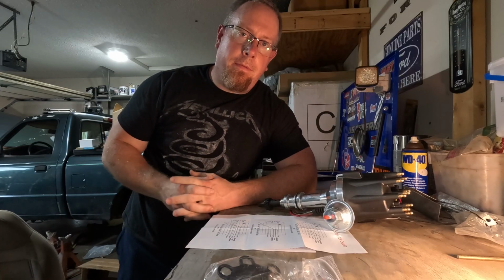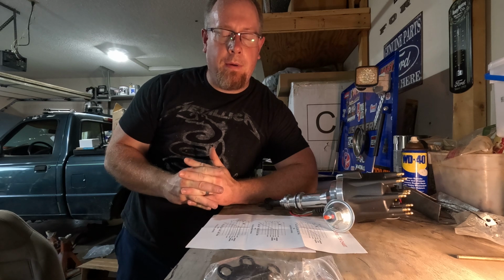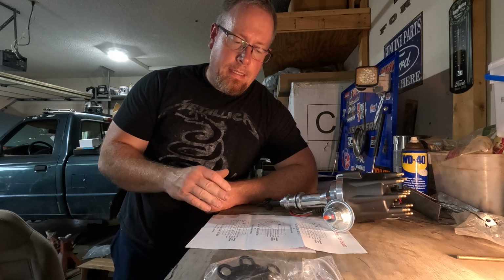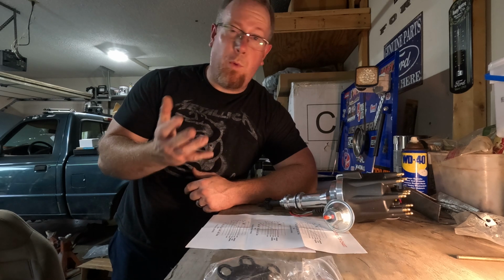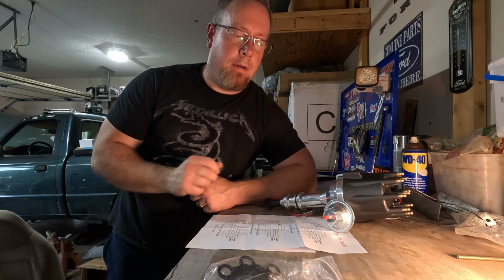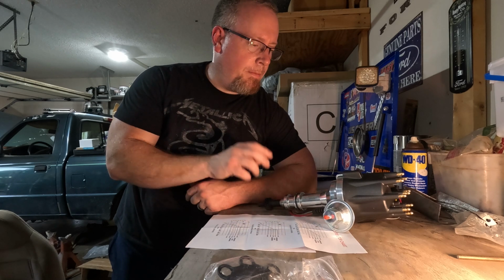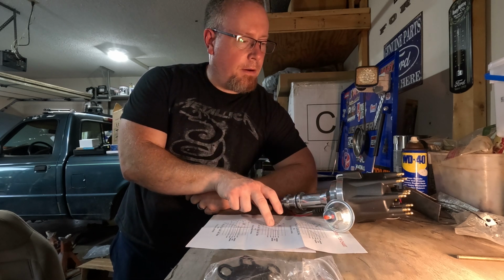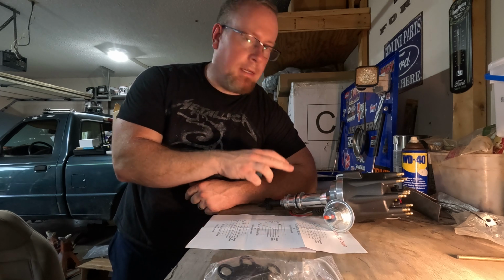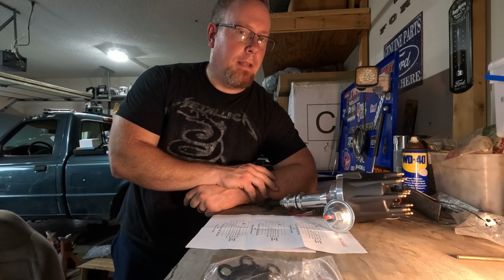With this information, we're able to figure out kind of what we want to do with this distributor. If we have a very light vehicle that is able to accelerate very quickly, we'd want to go with light spring. And if we're going to have an advance that's sub 20 degrees or something like that for the initial setting, we're going to want to run no bushing whatsoever. As this distributor comes, I believe by looking through the documents, it has the medium springs in it already, and it must have one of the 2 black bushings installed on the mechanical advance limiter. So we're going to go ahead and set this up for how I plan to install it later.